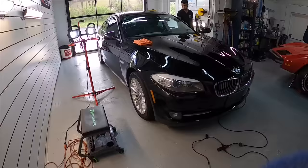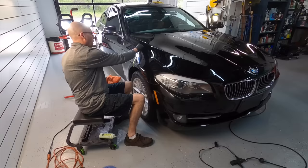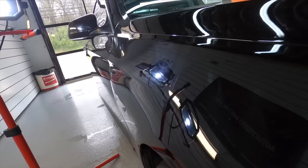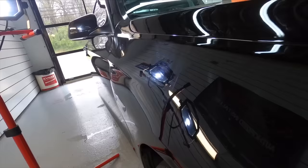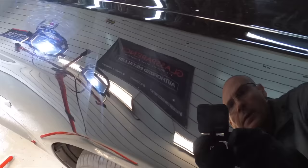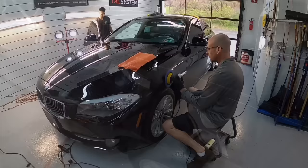That's what we're going to use to go all the way around this vehicle doing the cutting. The side of the 5 Series has even more scratches and swirls, indicative of running through a car wash with the wraps just doing a huge number grinding on that clear coat. There are some imperfections that run through the clear coat and some that are almost through — those are just not worth chasing after. We're going to leave as much clear coat as possible as this vehicle has a ton of miles to go on the PA roadways.